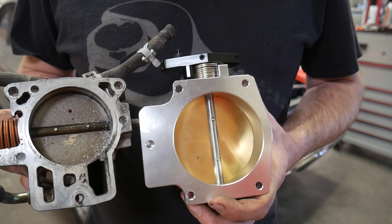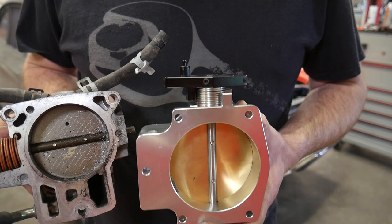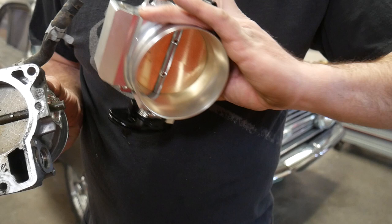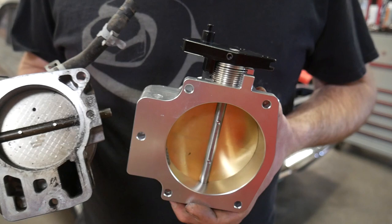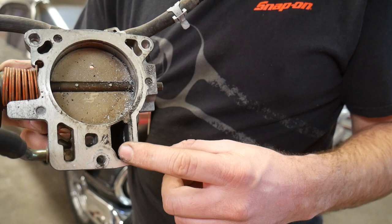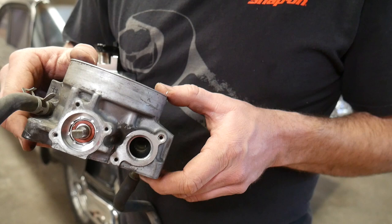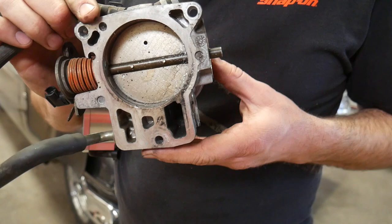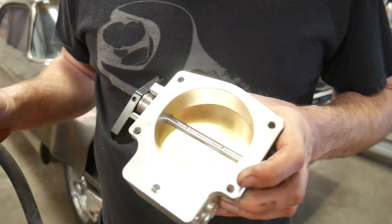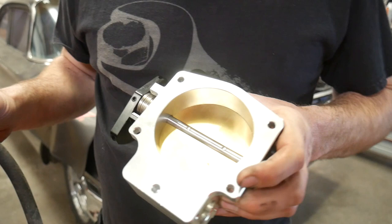At first I was just going to drill a hole in the throttle plate to see if that would fix it, but that's not something you can really undo — I could have put a brass rivet in it to patch it, but I didn't want something I couldn't fix. My porting in here, I can't fix that either if it didn't work, but I had to do something because it was outrageously loud. On this OEM throttle body, this whole big section is where the air dumps out of the idle air control motor — look how big that area is. It still has to go through the same size port around the pintle, but since there's such a big area around that pintle, the air doesn't whistle around it. So a very large port out, huge port coming in — I tried to mimic that in this one. I can't go quite as big on the outlet as I did on the inlet, but I smoothed out that inlet, and now I just need to polish it up.